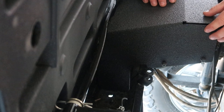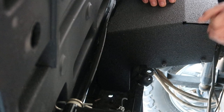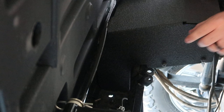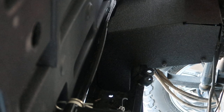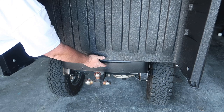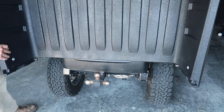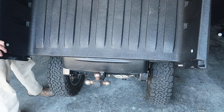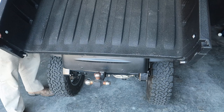The other pivot point that is stock on this golf cart is right down here. The stock version of the Cushman had a gas strut that would attach here and attach to the piece on the bed. It also had a metal or stainless strap that would limit the travel of the dump bed so it wouldn't stand up vertical like it is now. The dump bed is pressing up against this piece down here, and that's what the limiting strap would have prevented.